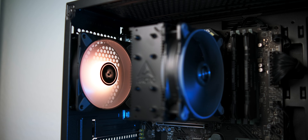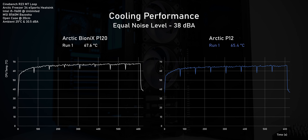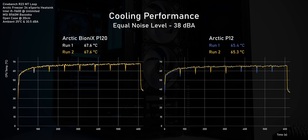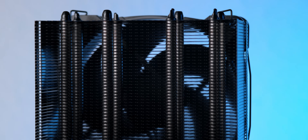And the Bionics coming in as the worst is also a bit unexpected — it's the most premium fan that Arctic has to offer. In fact, I even ran the test for the Bionics and P12 again and there was virtually no difference to the first runs. So I'm confident to say that if you have a Freezer air cooler and you would like some RGB, then go ahead and change the Bionics fan for the P12 RGB. There's no real compromise in doing so — if anything, the RGB fan will actually perform slightly better.